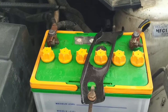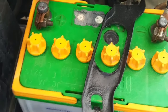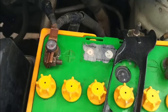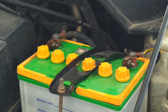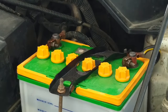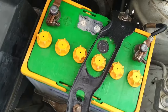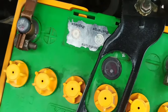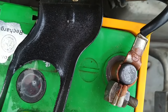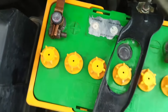Let's check a few things before we start testing. Make sure that the battery isn't bad — a lot of times it's just a bad battery and not the alternator. Check out our video on how to test a car battery; your battery should also be fully charged. Quickly check the wiring for kinks or loose connections. If they're loose, corroded, or sulfated, clean and tighten them. More often than not, that will fix any starting issues. Some dealerships will tell you it's a bad battery or alternator issue when it's only a bad terminal-to-post connection — can't stress the importance of clean connections enough.